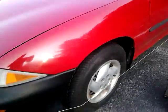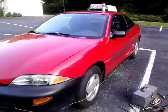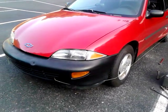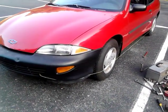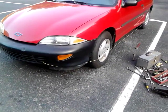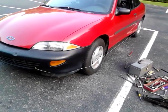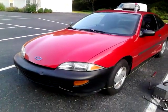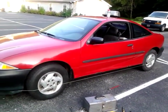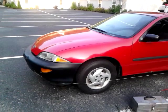That has your tires straight with the rear end. The thing is, to handle a little bit better, it's supposed to be toed in just a little bit, and you have to check your specifications to see how much toe-in your car normally has. I'm probably just going to give it an extra turn or two and call it good - maybe about another turn - then tighten everything down. That is an easy and quick way to align your front end without having to pay a big shop a whole bunch of money, and that will save you money on your tires also.